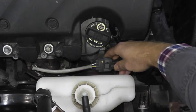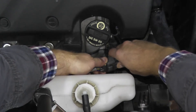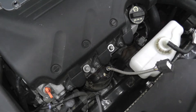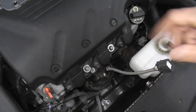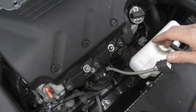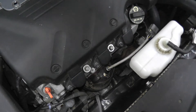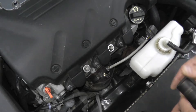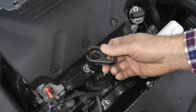Right here there's a tab where my thumb is — you can hear it click. Hold down that tab and pull on the body. Now you can test this sensor while it's still attached to the vehicle. I'm going to remove it just so I can place it on the bench, give you better lighting, and have more working room. In some vehicles you may be lucky and can slip a very long socket — in this case it wouldn't work, the wire's too long. But we were able to fit a socket on a Maxima. Sometimes you could fit a wrench.